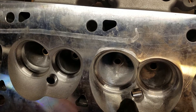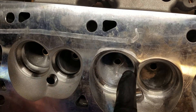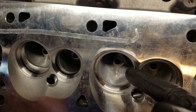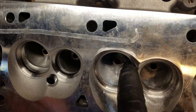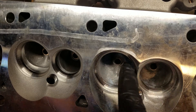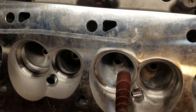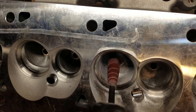I'm working this side because I want to make sure that when it's coming through where they machined this, it's not stepping out past where they have the seat insert. I don't want it going out at that insert and then going back in — I want to smooth this transition here.